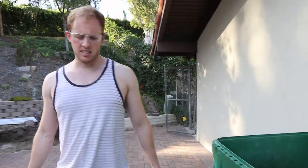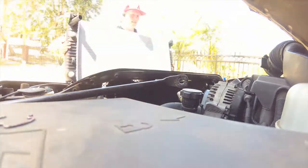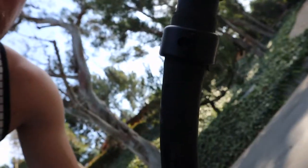That's it — we're done. A tour of what we did: we put the new radiator in. You can't see it because there's a fan shroud covering it. The other thing I found that was bad was those heater hose connectors back there — I made a video about swapping those out. You'll notice the hose from Chevy, the one that came from the factory, the clamp doesn't come off unless you cut it, and I'm not going to cut it, so I just used a hose clamp for that.